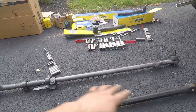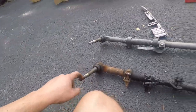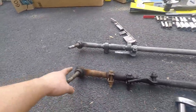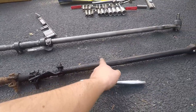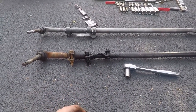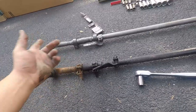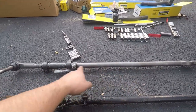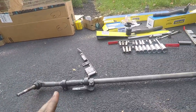If you're not going to replace the whole thing, what you can do is take a tape measure and roughly measure from dead center here to dead center on there. If you're just replacing one of them, take your tape measure and measure from about center on the drag link to a reference point — that would help keep your alignment the same so you wouldn't have to worry about anything. One thing that's nice about replacing everything is you don't have to mess with that. Also note that on the drag link end there's a reverse thread, and on the regular end they're obviously just right-hand thread — so just throw that out there so you're aware.